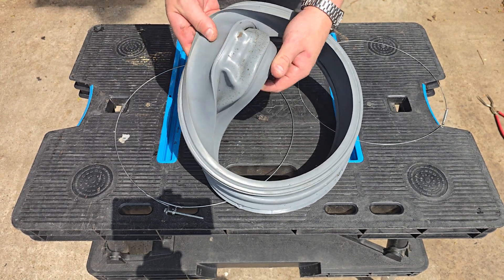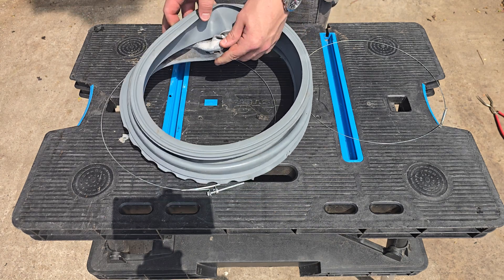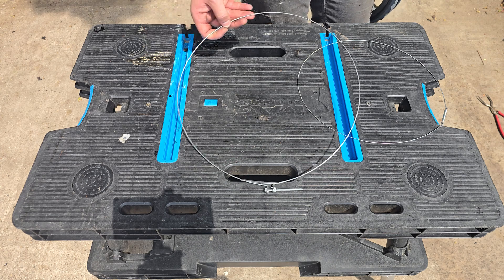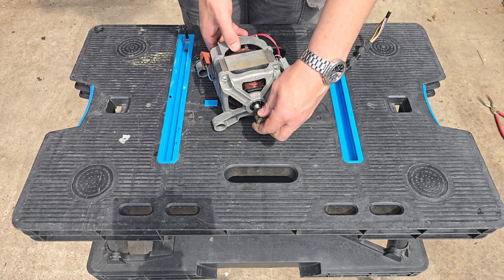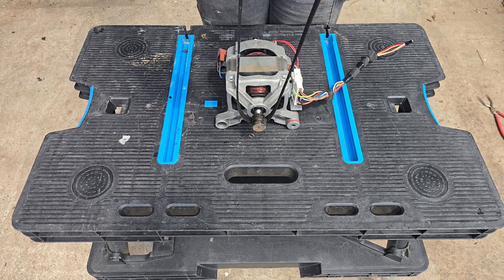Keep the door seal well maintained — dry after every wash to prevent mold build-up, and leave the door open. Very common for these to get damaged if you're not checking your pockets. Easy enough to change on your own without tools. The inside clip can be tricky for beginners but, as with anything else, it's easy when you've done it a couple of times.